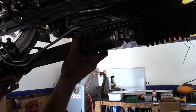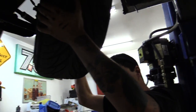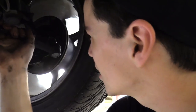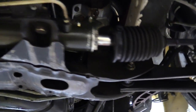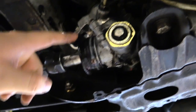It actually looks pretty easy on this car. We can't tighten it anymore, so we decided we're just gonna do the rack because it's messed up anyway. We have to drop the tie rods — go get the tie rod puller from your house. That'll probably be the hardest part. Drop the tie rod, four bolts for these, undo the fittings, and then the steering shaft. I realize I'm pointing with my finger and not pointing the camera where I'm looking.